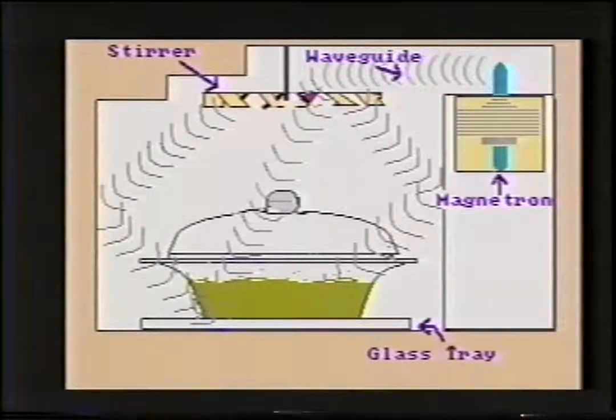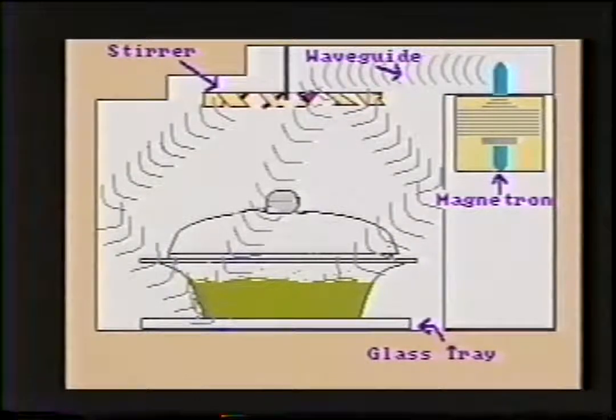Microwave energy will pass through many materials such as glass, china, paper, and most plastics. Generally, these are great cooking utensils when cooking with microwaves. Other materials such as metal or foil will reflect microwave energy and may cause it to spark inside the cavity. It could also shorten the life of the magnetron tube because of the extensive backfeed of RF energy, which raises the temperature of magnetron filament.